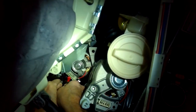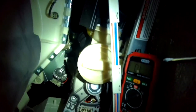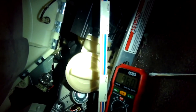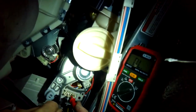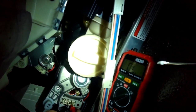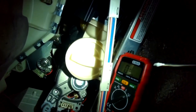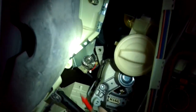This isn't a critical step — it's just fun to diagnose what happened with the old motor. If you put your ohmmeter on the first two pins from the top, you should get about 5.9, and the next two pins down should be about the same. On the old motor, the first two pins read 5.9, but the next two were open, showing no continuity. So one of the little wires inside just burned up and broke.